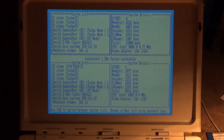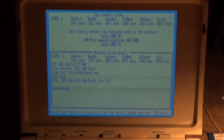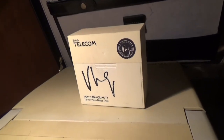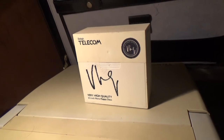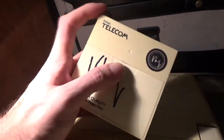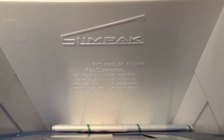Also worth noting that we do get a slight improvement using a CRT. If we press the CRT button and send signals to our non-existent external display, it ticks slightly faster. You can even hear that. Although there is something I should point out: if I do this, it gets a little bit faster when you're using a CRT, which we don't have. So yeah, using the LCD actually does slow the machine down in some way, which is a little bit weird, but yeah, I don't know. I imagine it must be relying on the CPU or something, or maybe it changes some timing on the video controller. I don't know. We'd be here a while if we looked into it, but either way, it does something. There is an effect on the system.